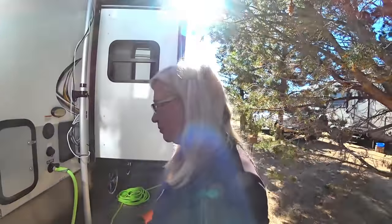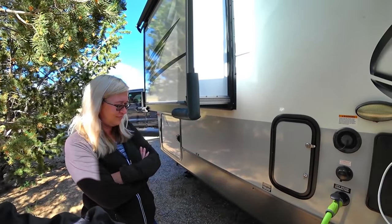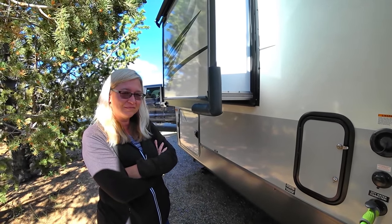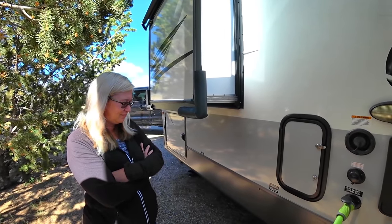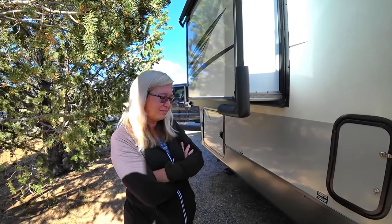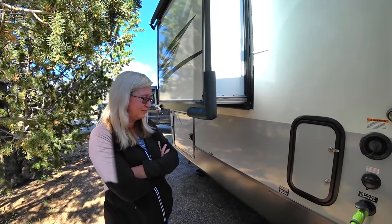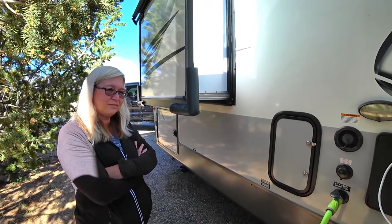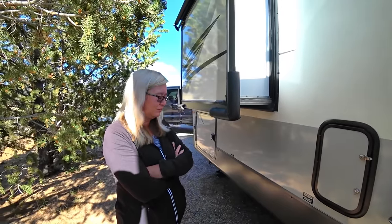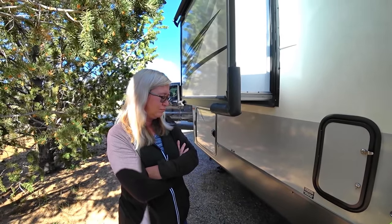So what she means is after this is all flushed and empty, right now we're running a flush on it. I'm going to get to the other side here because you guys are in the sun. She'll run a flush that goes to the other side of the RV and cleans out the tank. And then afterwards, of course, we shut off the flush and we shut the tank in its closed position. And then we'll fill the toilet bowl about 4 or 5 times, completely fill it and then flush it. And that will give us a lot of water in there to start with. And it seems to do good. It keeps everything away. The smells don't build up, and the tank stays clear. It stays pretty clean, so.